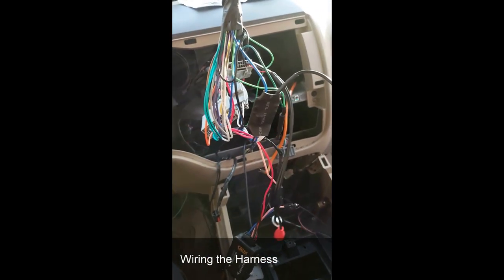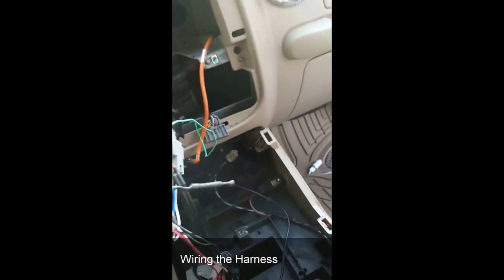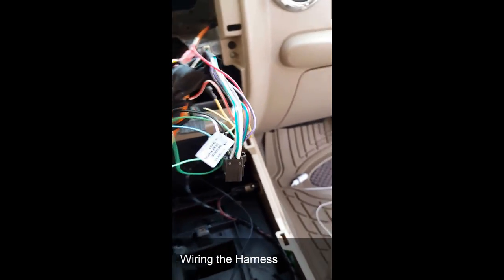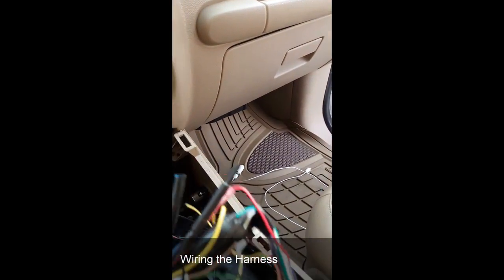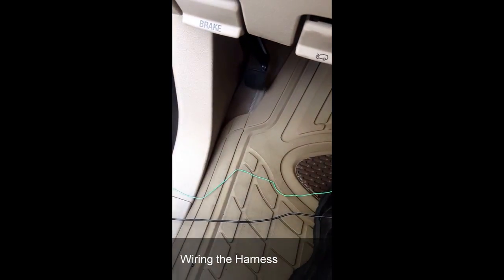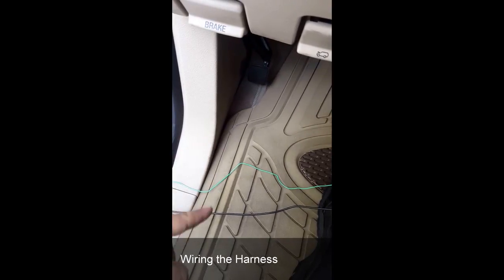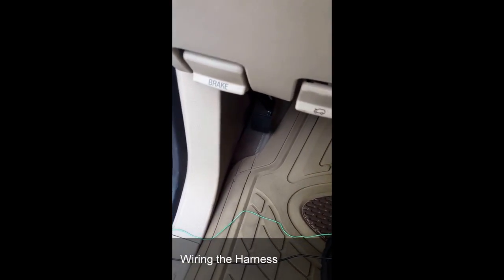A couple of things I did: I took the parking brake or reverse wire — this green one right here. I had a lot of it from the reverse gear signal, so I plugged it into the reverse gear signal, which is a purple wire, and ran it down. Somewhere in this pillar you have wiring that's part of the vehicle, so you should be able to find the reverse wire in this pillar — you just have to remove the cover and find it and tap into it.